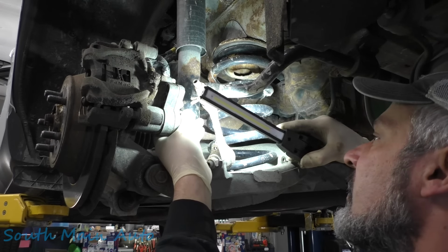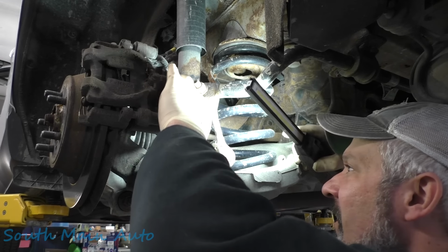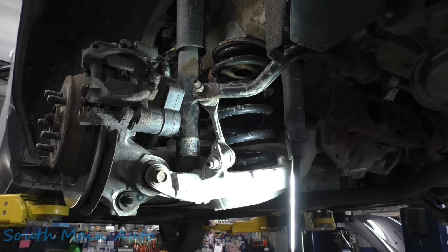Yeah, that one pin there, what color wire is that? The blue with green stripe. That one does look pretty crusty up in there, I'm thinking. Let's grab the test light here. Let me plug this actuator back in while I'm over here so we can hear if the test is running, because that would be good to know.